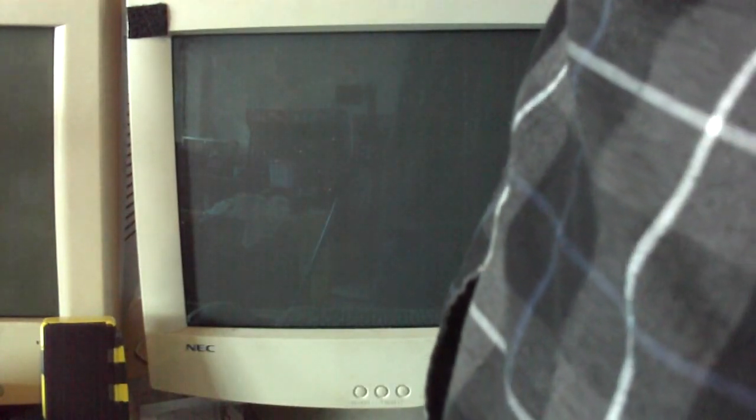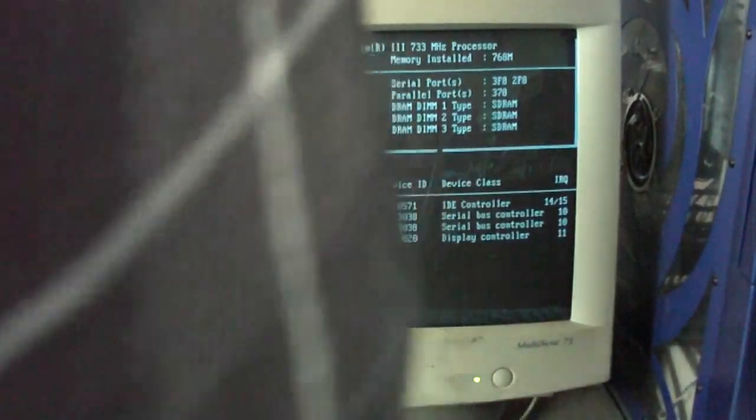Here's what we're going to do. First of all, we're going to shut Mr. Computer off. Come on, shut up. Off. Okay. Now, we're going to unhook the 80 gigabyte drive. We're going to leave the jumper settings where they're at and pull out Clonezilla because we don't need Clonezilla because it's not going to work. Okay. And so now computer starting. Found the Western Digital.